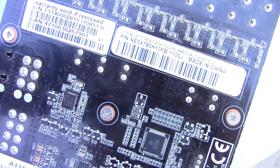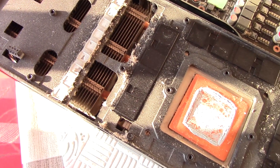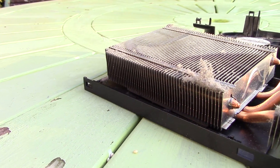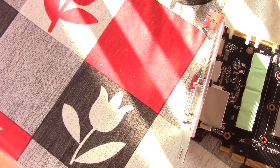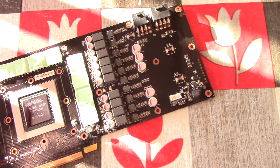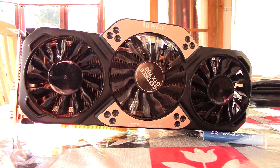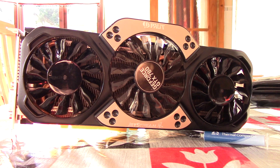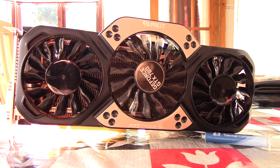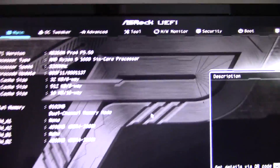The best thing to do was take it apart, assess the situation, and spend an hour or so removing five years worth of grime. The back of this had never been removed as far as I can tell — the original sticker protecting one of the screws was still in place. Taking apart a graphics card is always relatively simple and consists of just removing screws until the heat sink comes off. We also gave the thermals a quick improvement by replacing the old paste with some Arctic MX2.